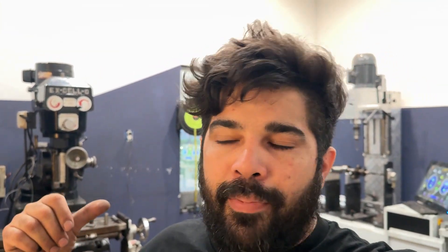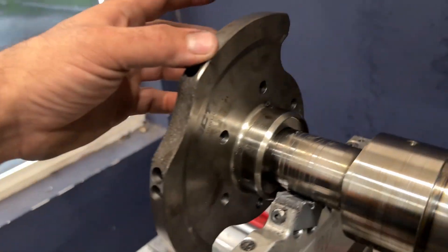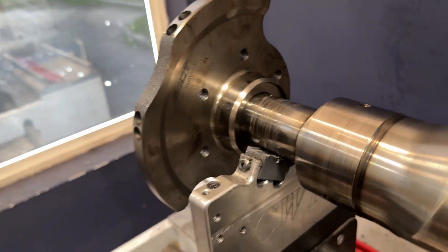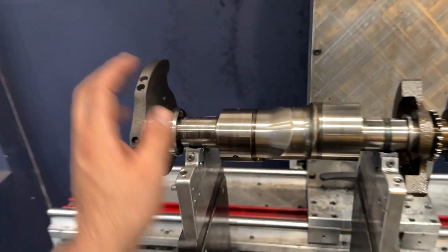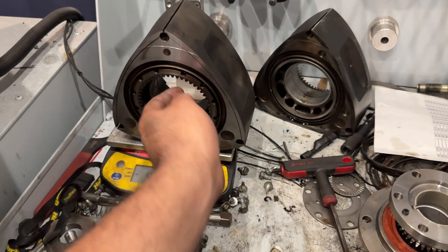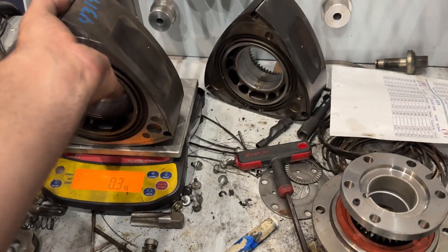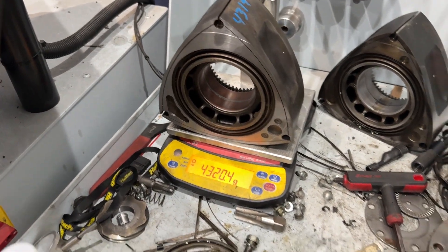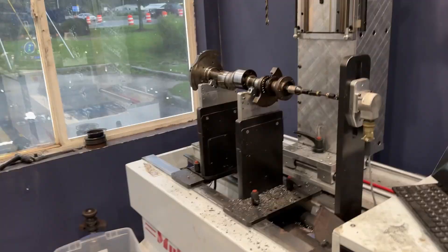Pretty much I'm gonna wrap up the balancing and give you guys a spin before and after. It's going to be a little off because we took 40 grams off each rotor. It originally came in with an ACT counterweight, which we know is not really balanced to anything specifically — it's just a generic counterweight that ACT sells. Now the rotors are weight-matched: we got 4320 on this one and 4320 on this one, so they're matching perfectly. Now we're gonna replicate the bob weights and spin the machine.